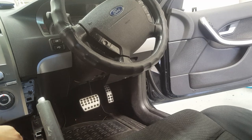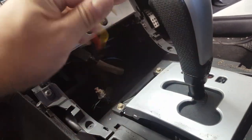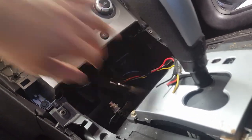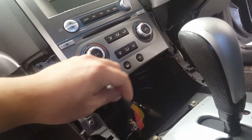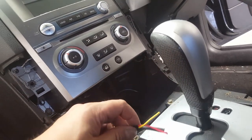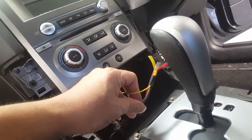What happened is basically we joined the wires running up underneath the steering column and popped it out of this little place down here. Did a hole down there, just popped it through. So that's all our speaker wires, power and earth. You don't connect the power and earth up just yet, just so you know. If it touches in the middle, it ain't gonna spark or anything like that, or short itself out. So we'll leave that to the very, very last bit, okay? So we've got our antenna, your front right speaker, power, earth, and memory.